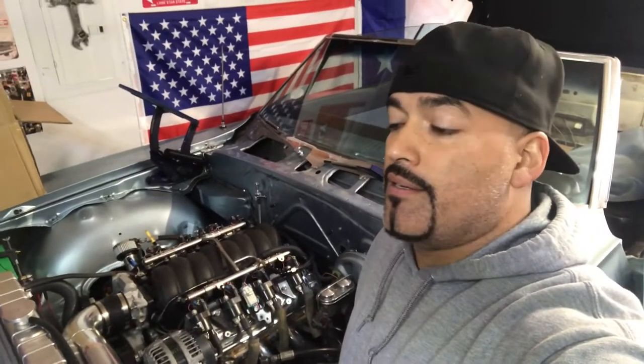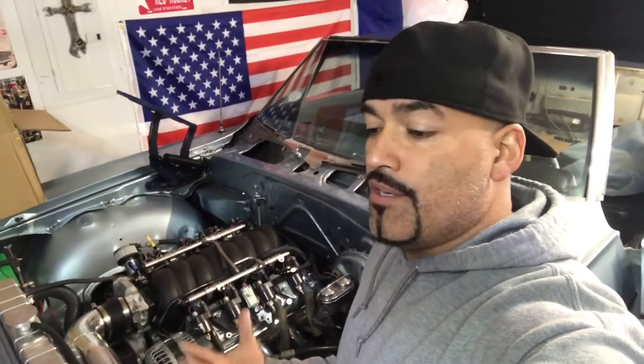If you've seen the previous videos we go into detail explaining what we've done to the car. It's pretty much a wrap — it's gonna go to the exhaust shop. There is a mobile tuner that is gonna be coming to get this thing tuned because it has a big cam and some other performance parts, so the tune on the computer now is just stock. The car doesn't stay on — it'll start but it won't stay on because of the big cam. Once we get that addressed, we'll have a walk-around video of the car running and showing y'all the dash.